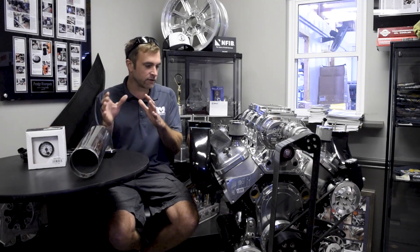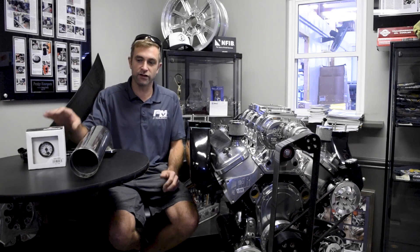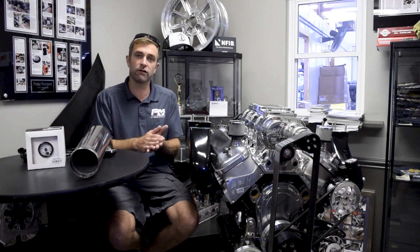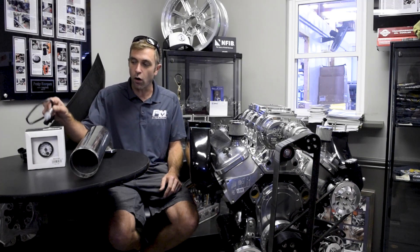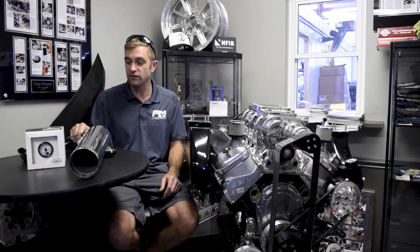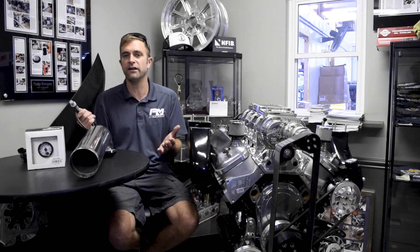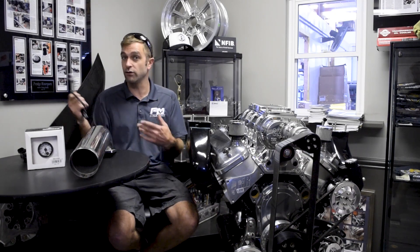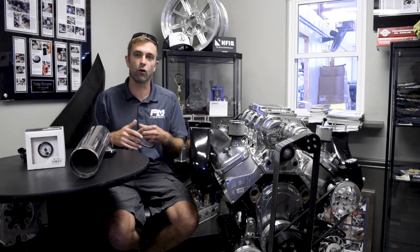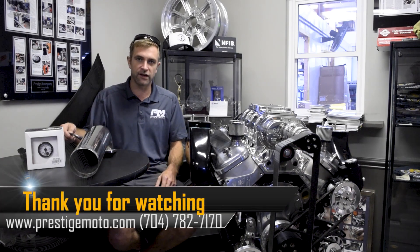That's kind of the kit — again, just an example of going the extra mile for the customer. We're talking marine here, but we encourage this with all of our hot rod customers on carbureted applications too. It's handy to always have an oxygen sensor gauge or air-fuel meter in the vehicle with a sensor in the exhaust — that allows you to properly tune the carburetor. And if it starts running funny one day, you actually have some data: is it running lean, is it running rich, maybe fuel boiling or vapor lock? It's a very handy tool to ensure you're satisfied with the engine package and that it's tuned properly in the vehicle. Thanks for watching, have a great day.